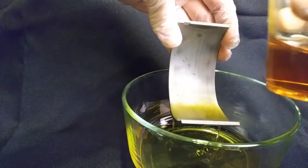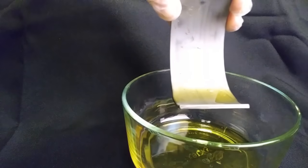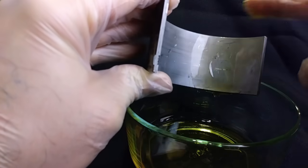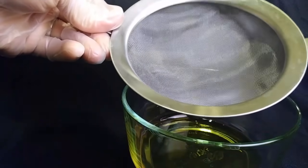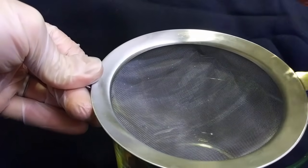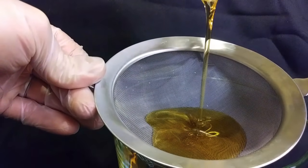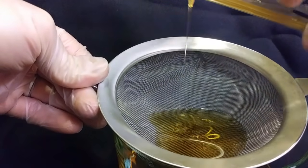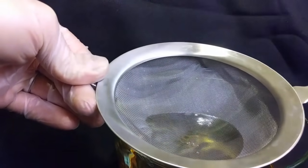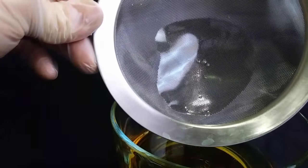You can see that the 15W40 at 65 degrees pours freely — it's a little bit thicker than water. It runs off the bearing easily. This would not cause any poor conditions or performance in the engine. Remember, the 15W40 had a minimum operating temperature of 15 degrees Fahrenheit, so anything above that it should be okay. Now we're doing the screen test — pouring this cup into the screen to see how long it takes to gravity feed through. As you can see, it is pouring through rather quickly. Should not be a concern at about 65 degrees with the 15W40.